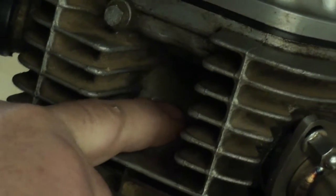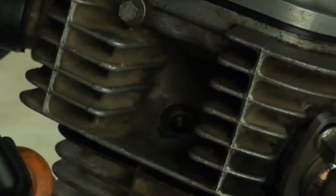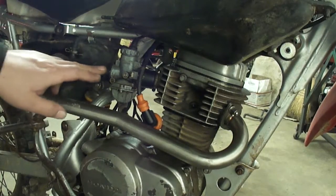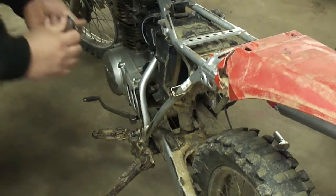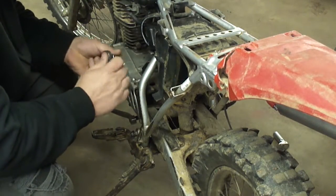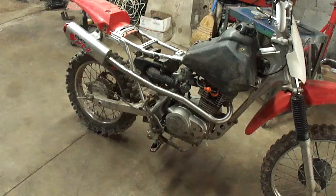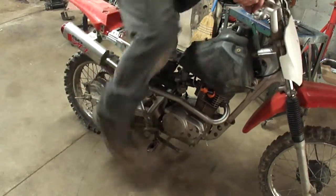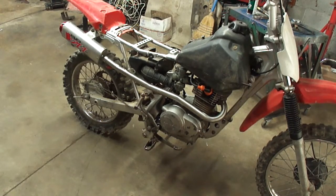Just a quick compression test — I'll stick my finger over the hole. Yeah, there's something there, that's a good sign. So the next step is I'm going to take this intake boot off and spray some flammable juice down through its throat and just see if it'll pop or make some noise. Just a couple of screws here, about 10 millimeters. I'll spray some flammable juice down in the carburetor and see if it wants to do anything.